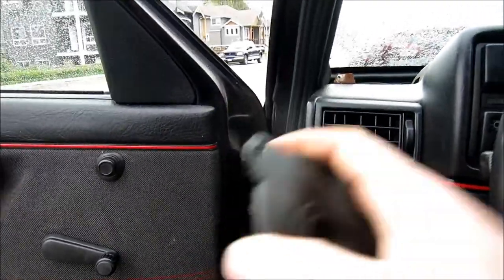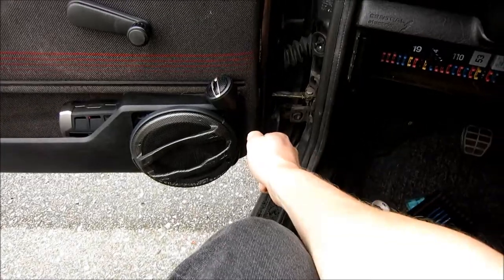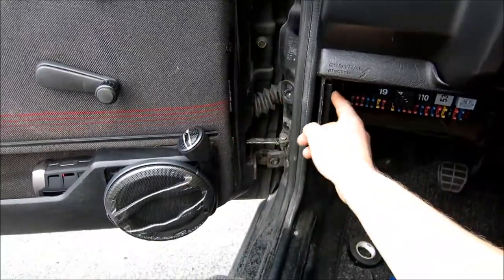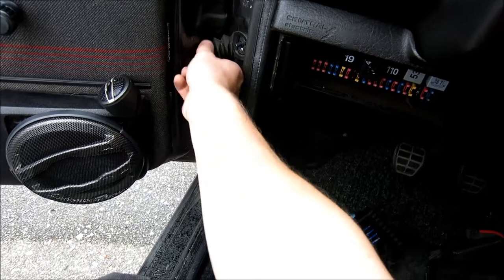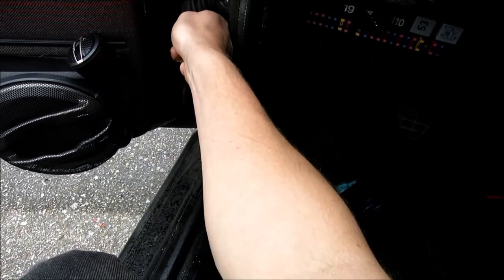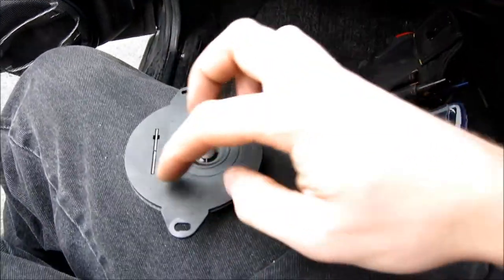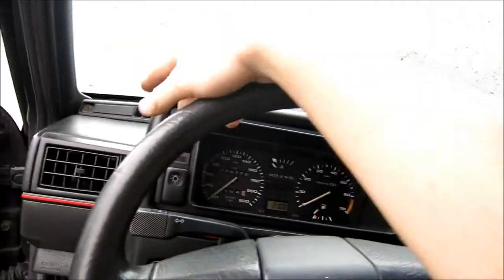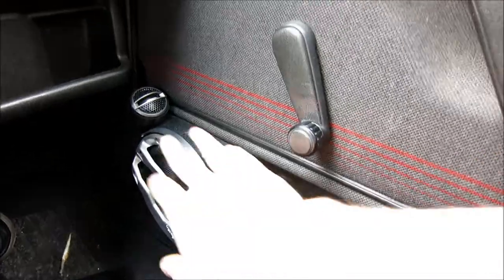If you are putting it up here, you're going to have to track this wire down here. Or what you do is you have the woofer wire down there, like I've already showed you. Once you've got your woofer wire, you could thread in a new wire back in here for the tweeter and just run it up here. It actually wouldn't be too bad because these grommets have lots of space in them — you can do it with a zap strap. This will pull out easy enough, just squeeze it with your finger, and then you could feed the wire in through here. If your glove box is open like this, the wire will come out right through here — grab it and feed it up here. Just a reminder before you start this up: make sure that you've unplugged all the other speakers so that way it's not going to impede your sound. As you can see, all nice and fancy.